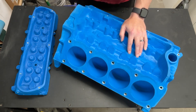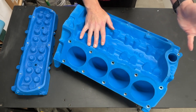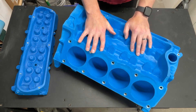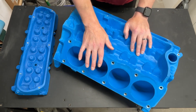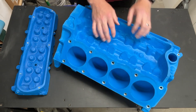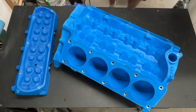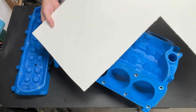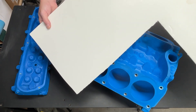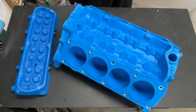Now there is some variation — some blocks have less deck height, some have a little more, so it is definitely plus or minus on that 1.3 inches. I also took measurements on my .351 block and confirmed that somewhere in the neighborhood of 1.3 inches will give me the height I needed. My plan is to use foam core board, cut it out in the shape of the heads, glue it together, and create a spacer to build up the deck height on this block.